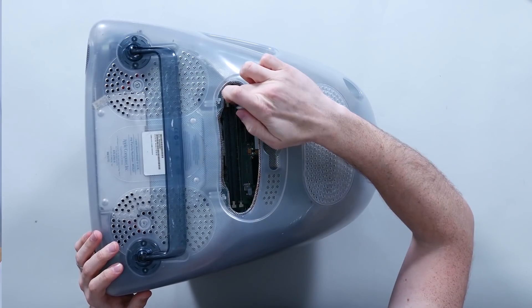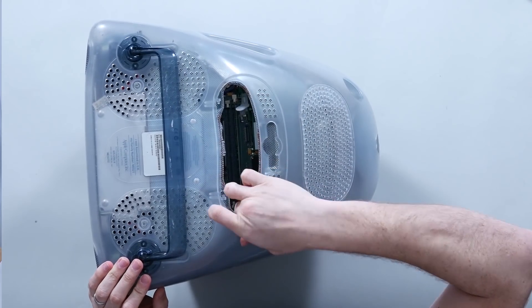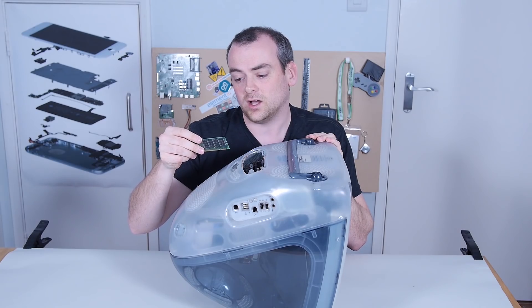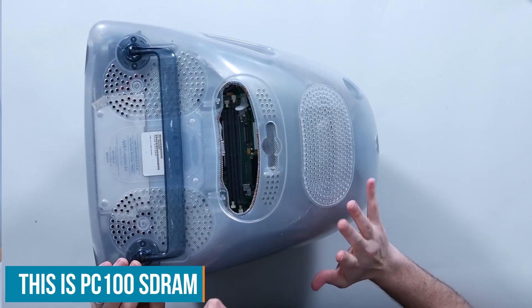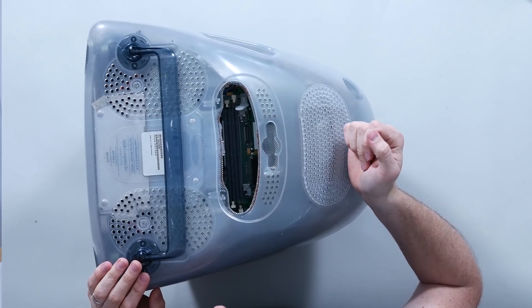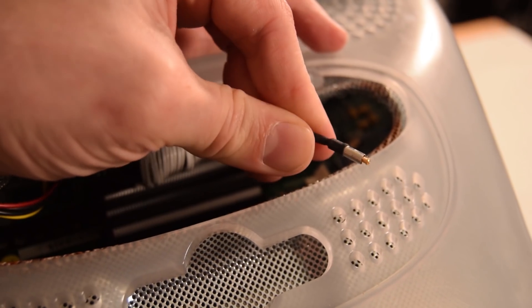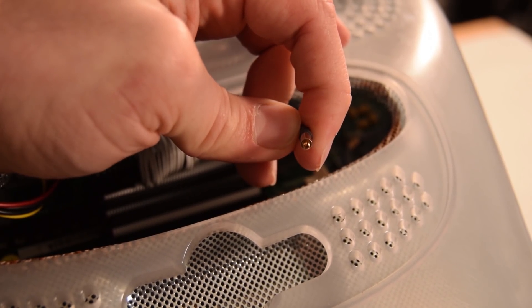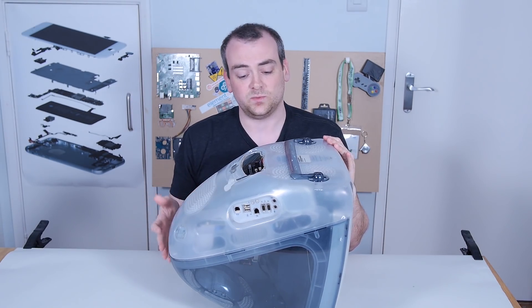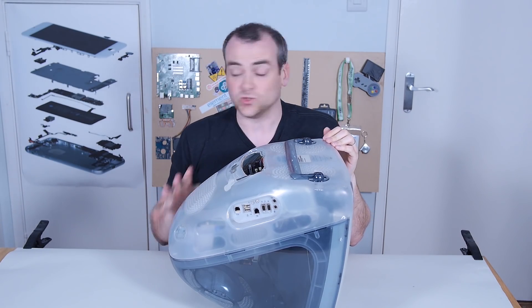First thing on the bottom is this little expansion port. In here we've got a DIMM — dual inline memory module. This is the only real upgradable part, and this is 128 meg. Interestingly, inside the port I can just make out another expansion port. The hint to what that does is this little cable — a cheeky little coax connector — which tells me that the expansion port is for an Airport card, which is what Apple called their wireless cards. Everything else came built in: Ethernet, USB, Firewire, and also a 56K modem module, which I'm sure we'll find later.